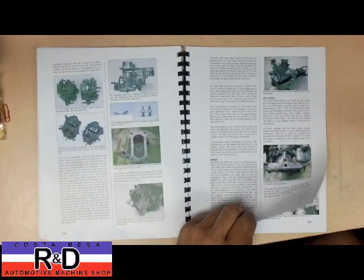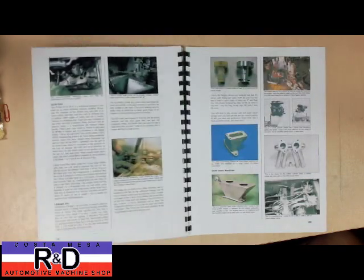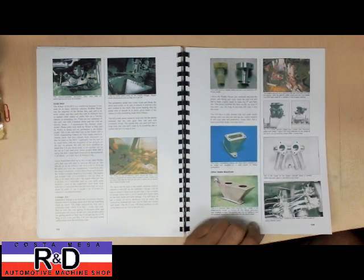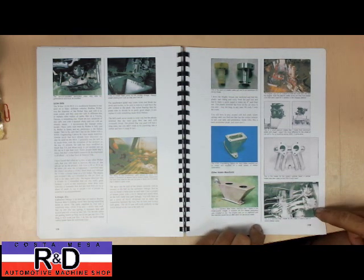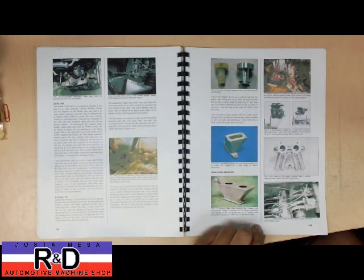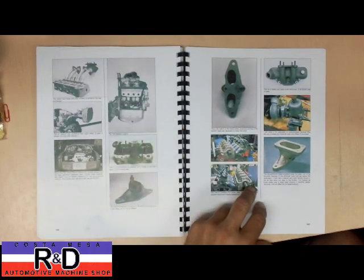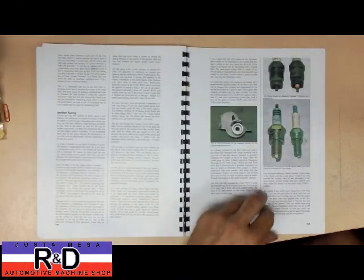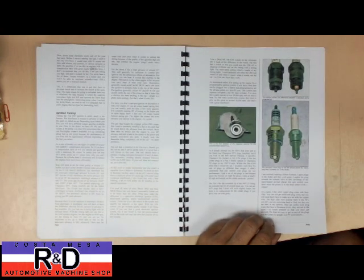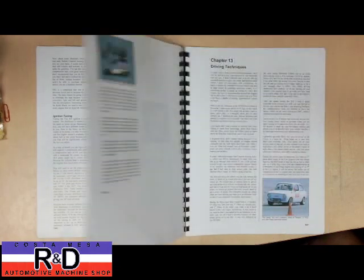Carburation and tuning. We'll talk about the 30DIC, the 30DCD, 2832 DHSA, and the 3236 DGV. And we'll show you some projects that we've done in years past to install 2 carburetors on a Fiat 850 aftermarket cylinder head, which worked out pretty well. And I'll show you some other stuff that we've done, some engines that we've built. Fuel system is kind of an important part of the overall operation of the vehicle, because if you retain the stock fuel lines, you're going to find that's going to be inadequate.